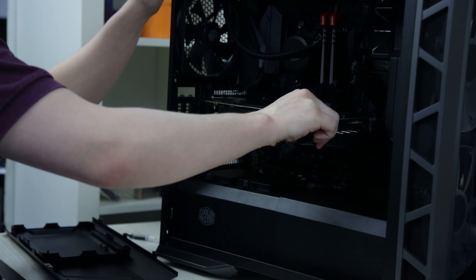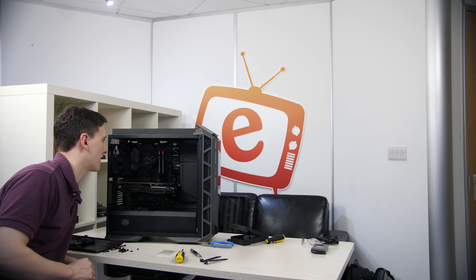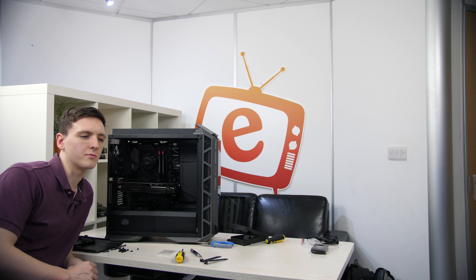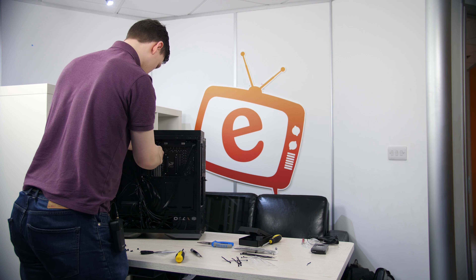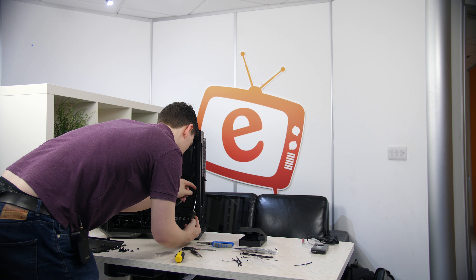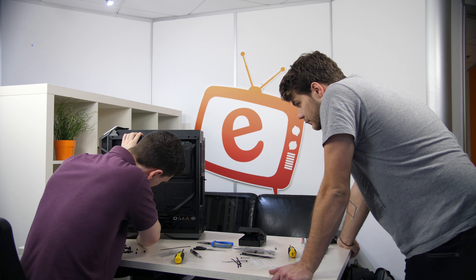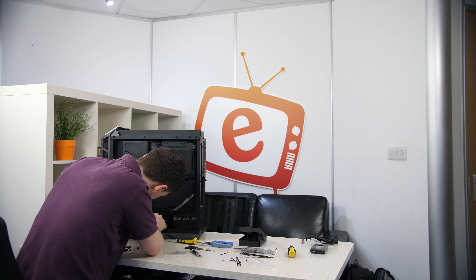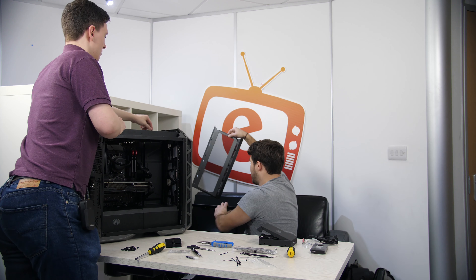The final and potentially favorite part is installing the graphics card - this is ridiculously simple. Remove the rear slot covers, make sure the little tab is pushed down, push the card in, connect the power at the back, put in the two screws, and you're done. The system is now fully built. We're going to do some cable management to make it look clean and presentable. Cable management is almost always a pain but takes time - in this case the covers on the back help hide the cable mess somewhat, though we did cable-tie things down to ease strain and improve the visual appeal.